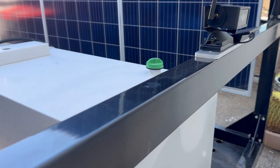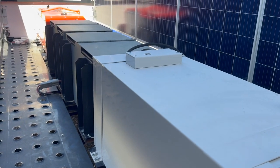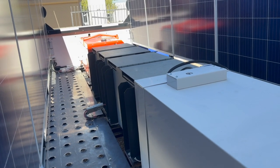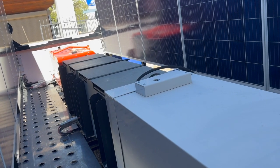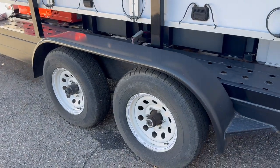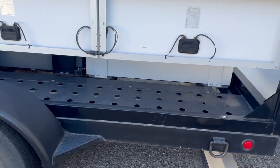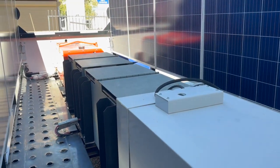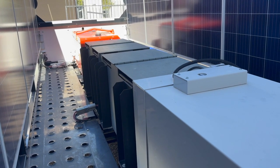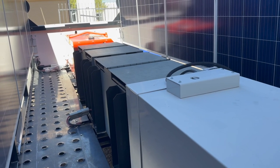What we're going to be doing is outlining this removal. I think we'll have to remove the fuel tank first, then roll the batteries back out. In their place, we'll put the EG4 PowerPro batteries — probably in the same orientation, one in the front and one in the rear, or possibly two side by side to get the weight around the axle centerline. I think the EG4s are 300 pounds each, so 600 pounds total, versus the lead acid units which I think are over 1,300 pounds each. It's going to be a substantial decrease in weight, which will be beneficial for the towing range.